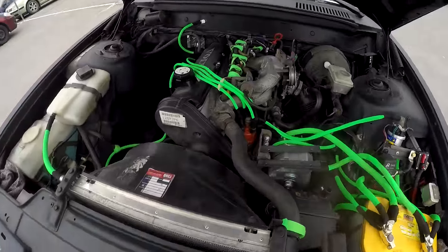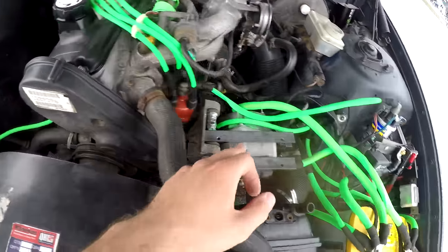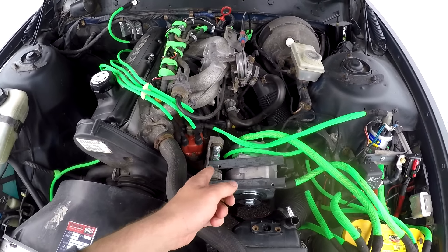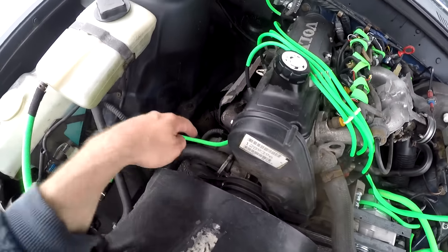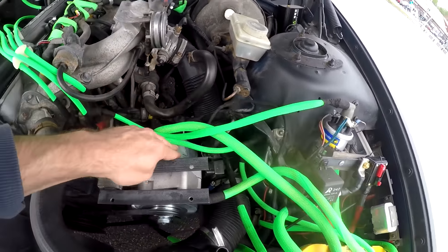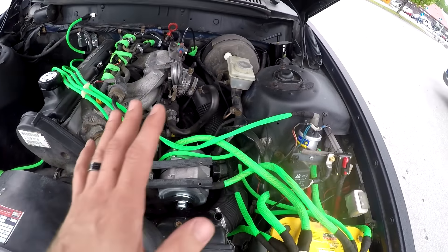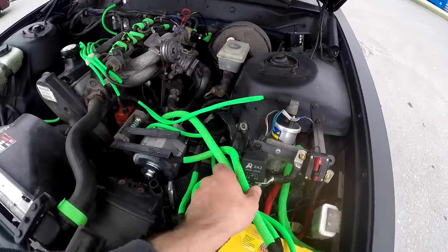Under the hood I have replaced my stock alternator and installed a 700 Volvo series alternator bracket so I can run two alternators. I have a 70-amp alternator there and a 200-amp alternator made by PowerMax USA — it runs quite hot. So I have a two-alternator system.